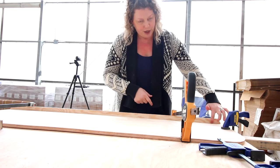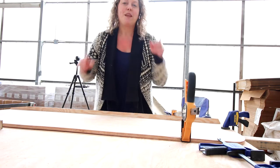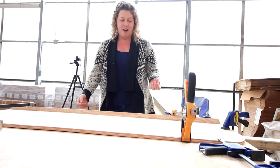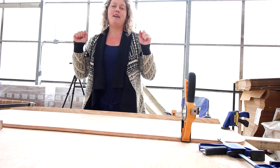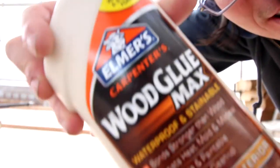What we have to do is put a thin strip of glue on this piece of wood. Once that's done, we're gonna push this in. We're each gonna take an end to make sure it's super flush. Push it tight together. Once it's tight and even and we can feel all the edges are lined up and flush. That's Mel's favorite word if you didn't know. Then he's gonna hold it in place and I am going to reclamp everything to give it the maximum support when it's drying. You guys wanna watch this happen? Hopefully it goes very smooth. Oh, flush! With Elmer's!